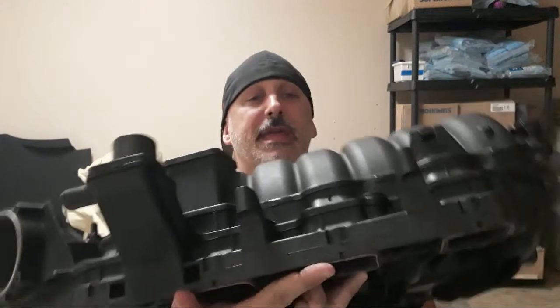A lot of times what ends up happening is that these engines are put together, and in the computer they're perfect, right? But when manufacturing processes come into play, you end up with kind of funky stuff when you get all these different pieces lining up. In this case, the back part, which is back here, is actually kicked up just slightly, which I thought was pretty funny. I've never seen one like that. I've seen a lot of them, all core shifted, but they've all core shifted in kind of a two-dimensional plane. They've never done what this one did, but it cleaned up so nice.